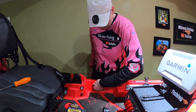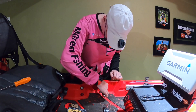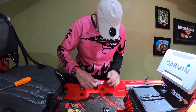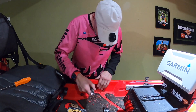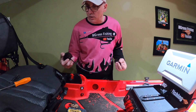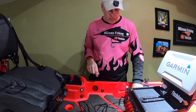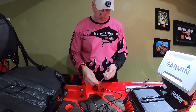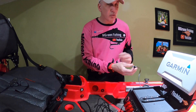After you've got the hole, you want to clean it. I got a utility knife for that — it actually made a really nice clean hole. You want to get rid of any little hairs of plastic on the edge, because you want that gasket to sit firm on there. I'm going to vacuum everything out and get a clean area to install everything. Now I'm going to fish the wire through using a piece of metal dropped down into the hull, then drag it with a magnet from underneath to where I need it to go.